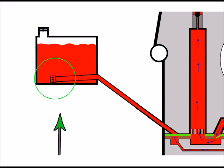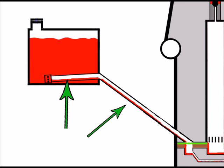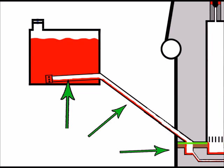Of course, there's just simply the option of removing the fuel filter for just a few moments and running the machine again, of course making sure that there's no dirt at the bottom of the tank that would suck up into the carburetor. But of course then it would eliminate whether it's a fuel filter issue or not. But of course, if the fuel filter is blocked, we can see the issues there. We can see it's not drawing in fuel down in through the fuel pipes there, and it's not going into the carburetor. Therefore, when we try and rev the engine up, we're going to get a small amount of fuel, if any. And if it runs at all, it's quite likely to bog down.